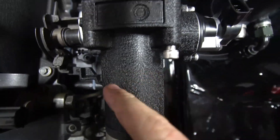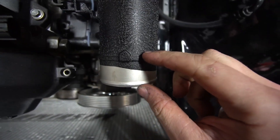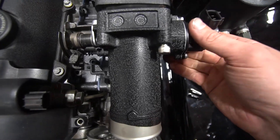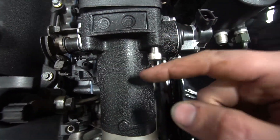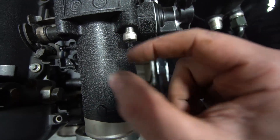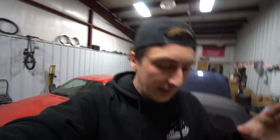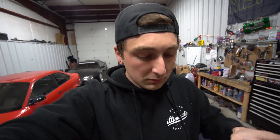But this is a good example of why before you commit to things, test fit a million times. It's okay - I know it's kind of a waste of time now, but we learned. Hopefully tomorrow I'll get to it. I'm actually going to be chopping it probably right here, and either welding a lip on it or utilizing this factory end and welding it up here. Brian had a good suggestion where we can cut it off right here and weld a piece of intercooler pipe that's actually a 45-degree, so we already have the bend in it.